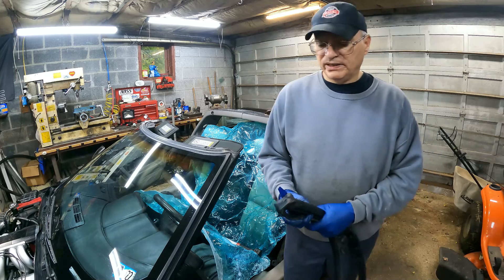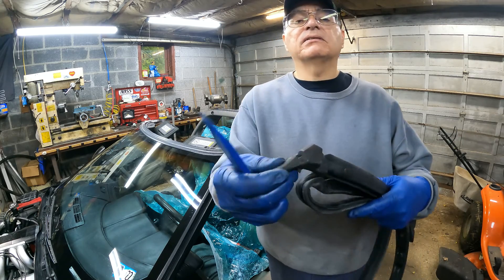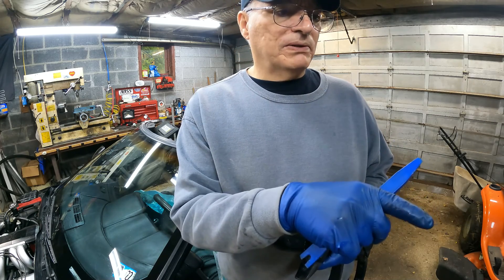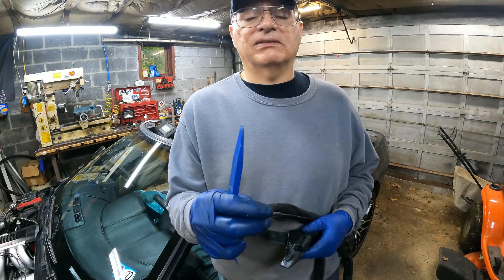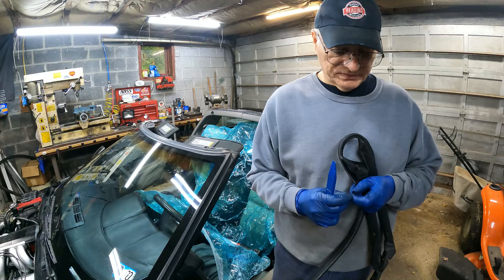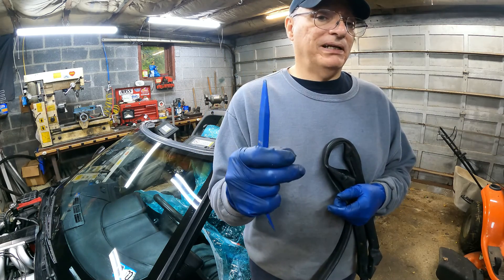The B pillar's off, and it shows how poor the light was, but I thought there were little seven-millimeter headed screws in there, but they're not — they're actually little plastic tabs. So whatever you do, don't lose these black plastic tabs. If the new weatherstrip comes with them, which I don't believe it does. And if you break them, don't get bent out of shape because you could just run down to Napa and get some new ones. Don't lose them — hold on to them. Always prepare to make a run to Napa.